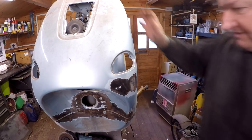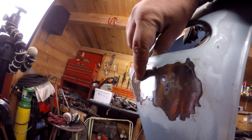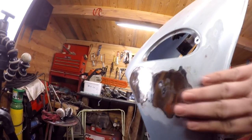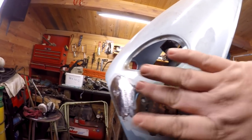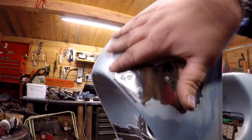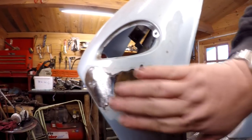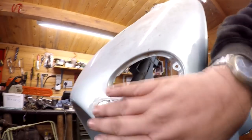Well, as you can probably see there, the dents are virtually out. The curve is virtually back now — all we've got is two tiny little dents where the paint hasn't touched. I've removed all them dents and I could really just dig this out with a bit of emery paper and put a little thin skim of filler over there and that's going to be absolutely perfect. So we've got our nice curve back again — I'm well pleased with that, that's a good repair done.